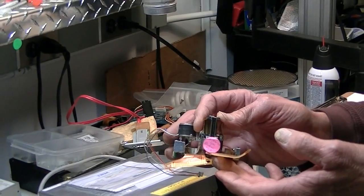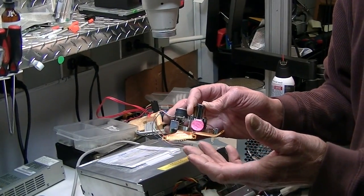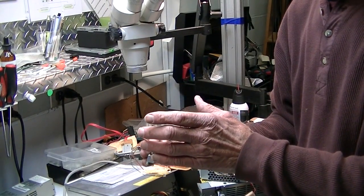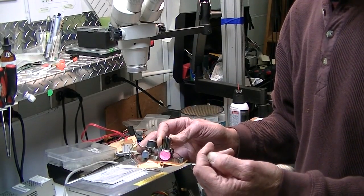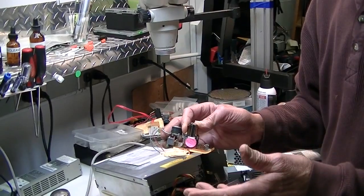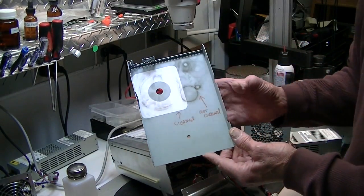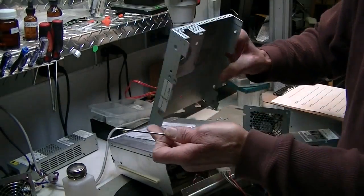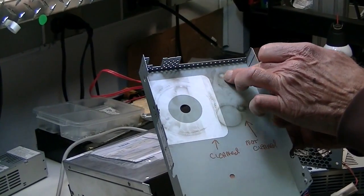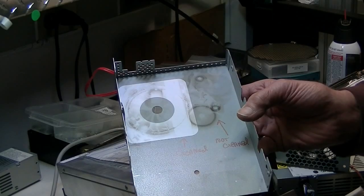The manufacturers expect you to use the proper tape for the tape drive you're using. We have two major manufacturers: HP and IBM. IBM standardizes on Fuji media and uses a heavier tape tension, so the surface of the media can withstand that. If you start putting HP tapes in an IBM drive — HP tapes are designed for a lighter tape tension — you're going to cause damage. When we take a tape drive apart, you can see all this debris built up inside, which gets deposited on your head and on the media, so you have to be cautious about the media you use.